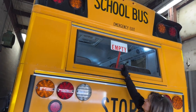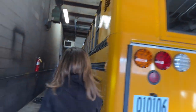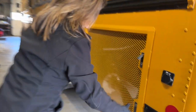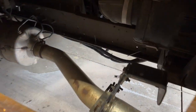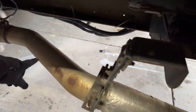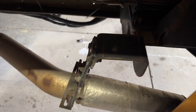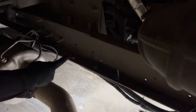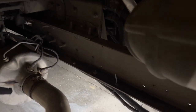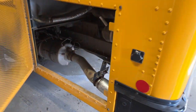Emergency exit — it opens, lights go on, buzzer sounds. Here's our exhaust system — it's bolted and mounted securely, not cracked or broken, loose or missing. There's no soot pattern that would indicate a leak, and if the bus was running, we would listen for excessive noise. We have a good view of our frame and cross members here. We already showed you the drive shaft. I would check the brake, suspension, and wheels the same on this side as I did on the other.